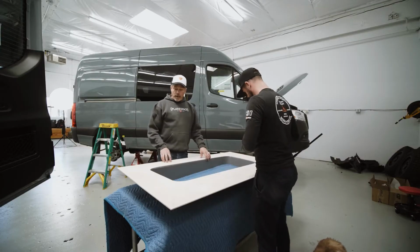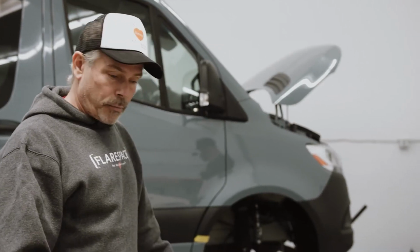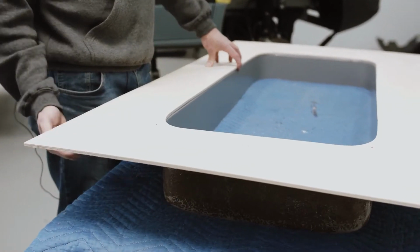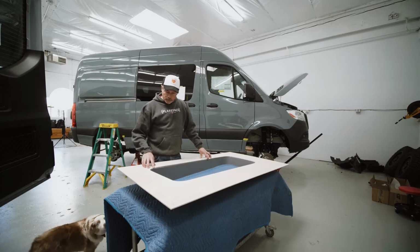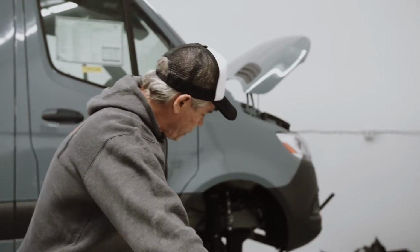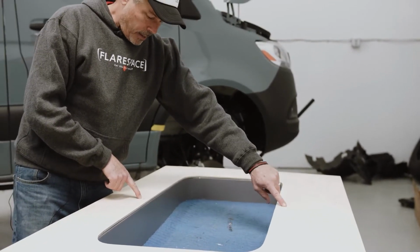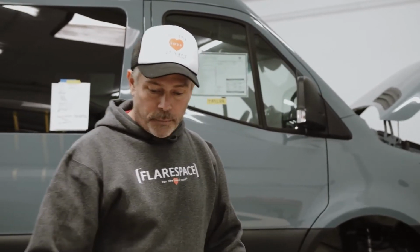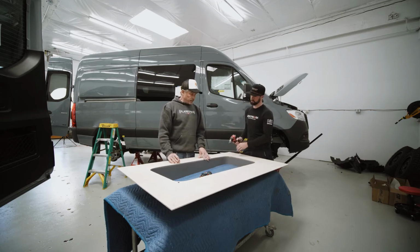All right, so we just marked the spots where we're going to screw this birch board into the flare. We're actually going to front mount this so you'll be able to see the screws, but you could mount it from the back as well. And then all that Leland did here was to measure this 1 inch off of the corners and mark it, and then measured the midpoint here and then 1 inch back in order to figure out where we're going to put these screws.